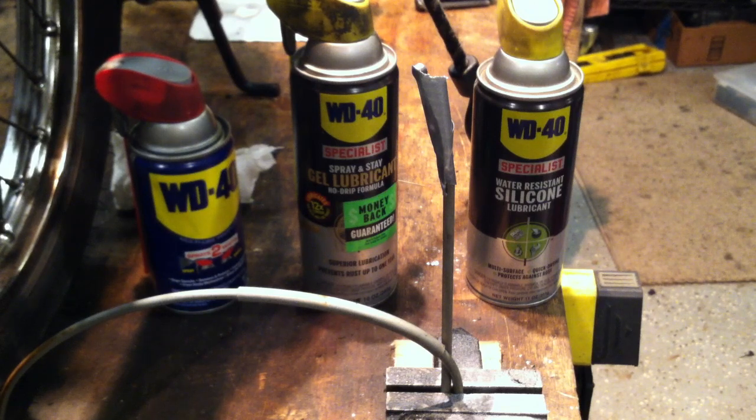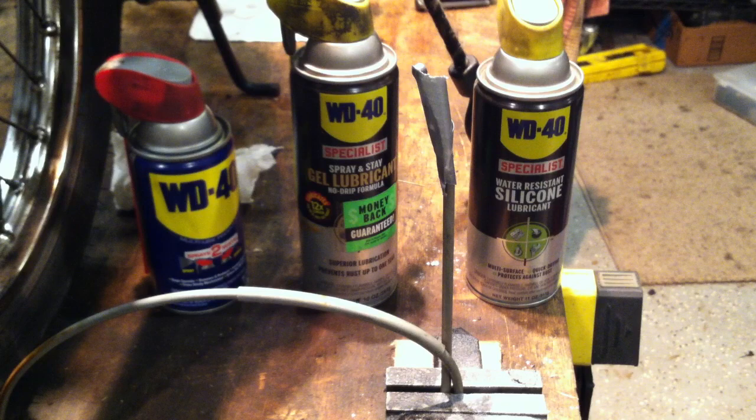I've got 32 QT50 virtually free tips. Number one: when you get a QT50, one of the first things you want to do is lube up those cables. When I got my first QT50 — this is my very first one sitting right up here on the workbench — I've had like eight or nine of these things, but I've only kept the first one. When I first got it, the throttle cable broke on me within like a couple days. Boy, did that suck.